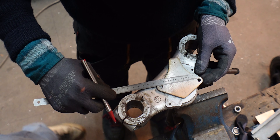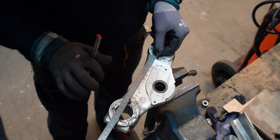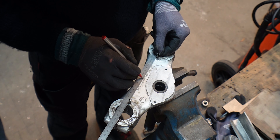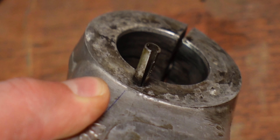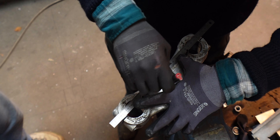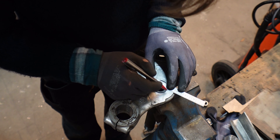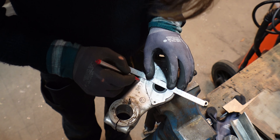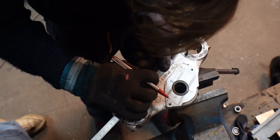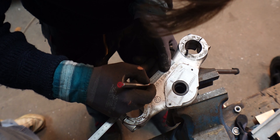Since we now have the final dimensions of the bracket, Nickel showed me how to take those and transfer them to the triple clamp so that I'd get a straight fit. He first took two symmetrical points that were relatively far apart and determined the center of the triple clamp. With the ruler pushed against the little locking stems in the triple clamps, he also drew a line from left to right as a reference. To finish the center line, Nickel then measured the middle of the steering stem to get a second point, and connected those center points to give us the center line, which we used to measure the right distance for the holes.